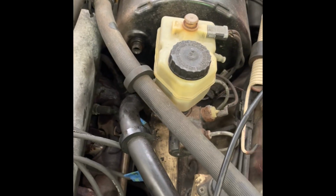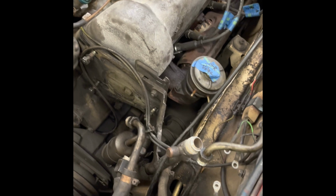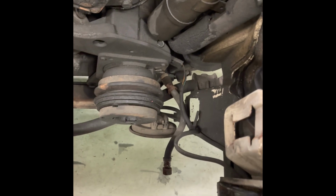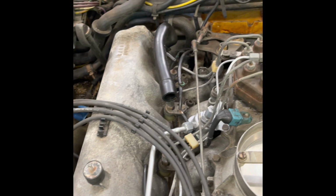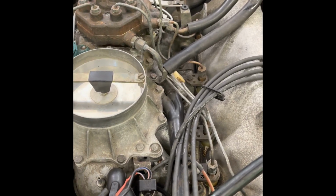So getting back to the rest of the car, a little overview, again, trying to reset my brain to figure out where I need to go next. Yeah, EGR valve is going to come off. I'll try to take the exhaust manifolds off. I got the AC connector off. So working on the wiring harness and then getting all of the spark plug wires out of the way. And then working my way back to the rear of the car, trying to get all the heater hoses released, the vacuum lines that are back there, the throttle linkage is still back there, and the fuel system.